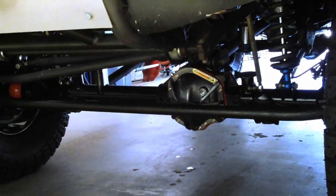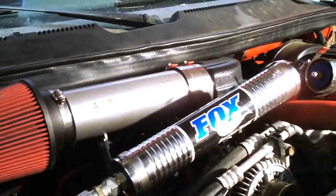First of all, it has a big camshaft — a low vacuum situation. It also has oversized tires. It's heavy, it's fast, and the stock vacuum power brake just won't cut it. Because of this Hydroboost unit, the truck's going to stop. So let's check this out — let's go inside.